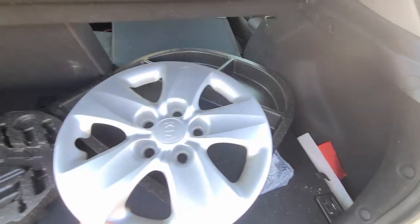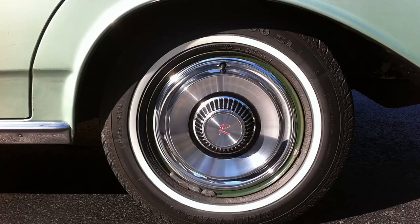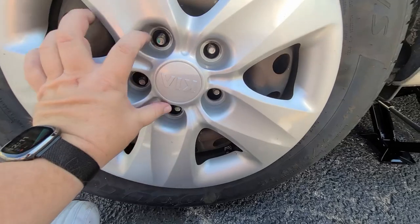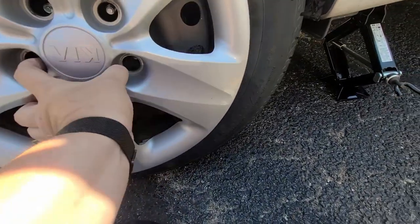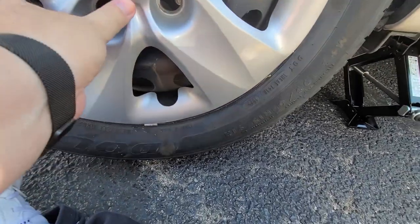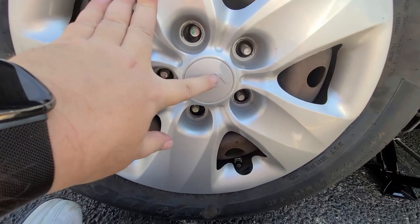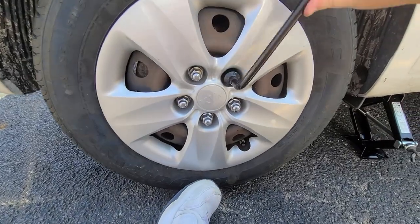By the way, I don't know why I couldn't think of this — this is a hubcap. I'm just used to old hubcaps looking like this. I'll show you a picture, but this is the hubcap. Jacked it up more. Now let's get the hubcap on there and make sure that it is even with the valve stem right there. Let's go ahead, tighten up these lug nuts, lower the car, and get on the road. There we go — tighten them up.